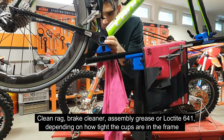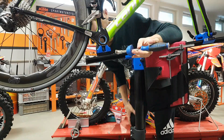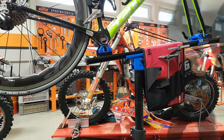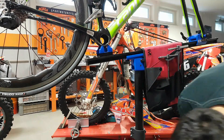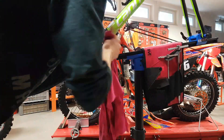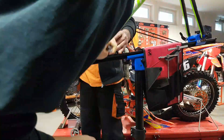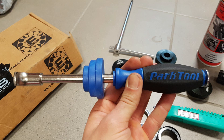The tools mentioned in the subtitles are exactly what you are going to need. And if you are a bit more careful than me, then you order the specific bottom bracket that your frame actually needs. The newer models use the PressFit 30A, which use cups into the frame. Like I have here — unfortunately I only ordered bearings, so I needed to remove the cups and then the bearings from them.